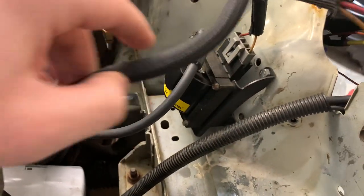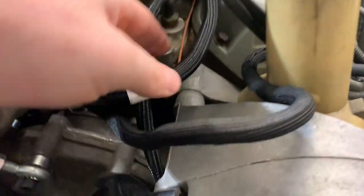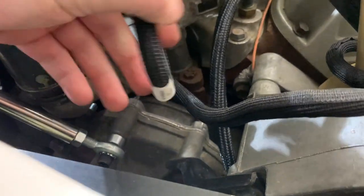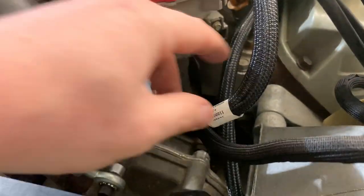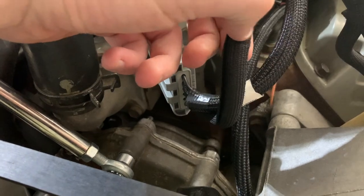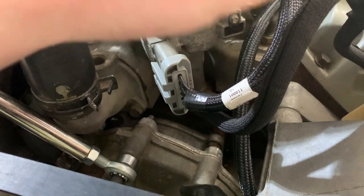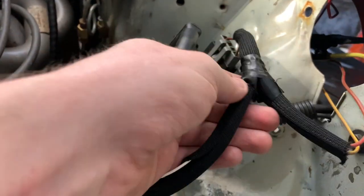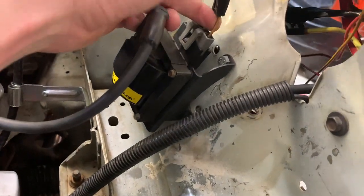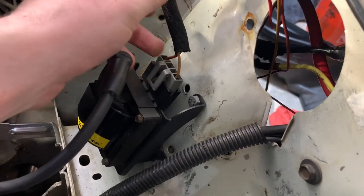The last thing for your coil is this white wire coming off the TFI jumper. On the Holley harness you have your plug-in for your TFI, and there's a little white wire that runs off of that. You take that white wire — it is not the points wire — and run it all the way back and splice it into your tach signal wire. All that does is give your Holley the RPM signal so you can see RPM on your gauges.